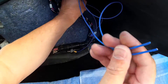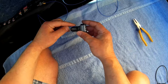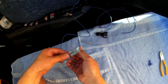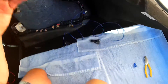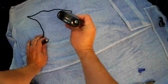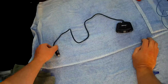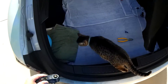So I'm going to run them up here to this guy. How do I connect it without being too much of a Frankenstein? Since this is permanent 12-volt and the chassis is all negative, it's a good idea to just insulate it — even though it's not fully bare, there's a little bit that could touch and create a short. We don't want that. Look what I just found in the garage in a box — that is actually brilliant. Now I have two 12-volt outlets and two USB ports. So I'm going to attach these two ends on this side here and then let this dangle out. Perfect.